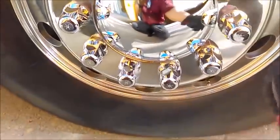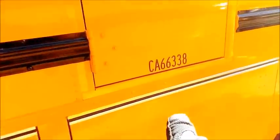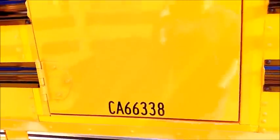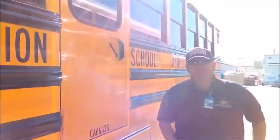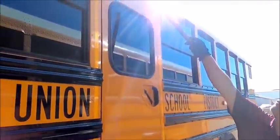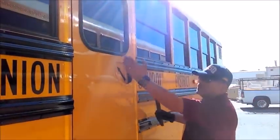The rim has no rust, cracks, illegal welding, or dents. Lug nuts are tight and visible with the caps on, and the stem is secure in place with the cap. Cargo doors are in place and secure. Reflective decal in place, district logo properly labeled, California logo and number properly labeled. I come to the emergency exit on the side: I check the labeled emergency exit—there's a lever to push—I open the door all the way out, confirm the locking bracket works, and check the seal to make sure it's not cracked or loose. This emergency exit is operating properly.